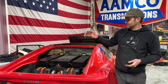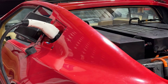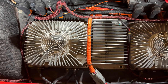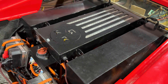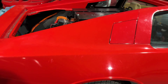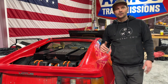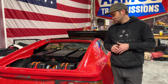So right now we're charging. It's got a driveway safety so that if I hit that throttle right now, we're not going to get wheels spinning. Because theoretically this will be sitting in your driveway or garage charging, and if somebody gets in, turns the key, and hits the gas pedal with that plug in, it's not going to yank that power cord out of the wall. We've got tires up off the ground — just testing everything. Batteries are charging.